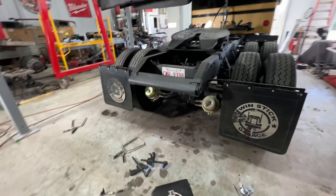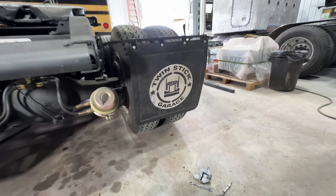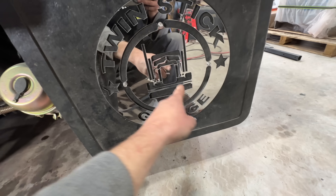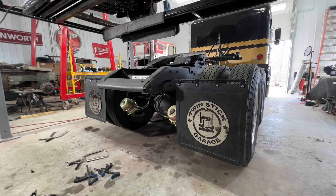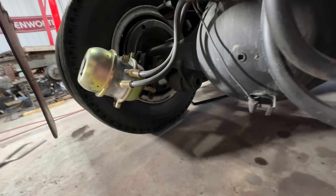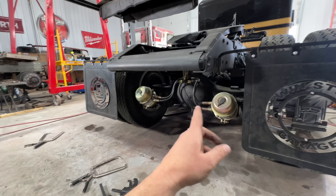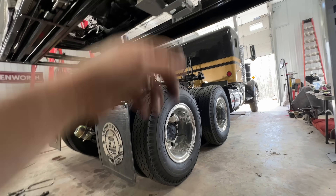Oh man, does that ever look good. I'm digging that a lot — great idea, Blake. Blake's idea was to just use quarter-inch Allen head bolts at the four points — that way it's subtle — and then put big fender washers and nylock nuts on the backside to keep them from coming off. Man, that looks sharp. So all that's left now is I'll air the truck up, release the brakes, and adjust the brakes — of course these are manual slacks. You tighten it up, then it's a quarter turn off and your brakes are set. I'll do the four corners at the back, get out the grease gun, do a little bit of greasing, and then see if the bikes will actually fit on that bike rack.